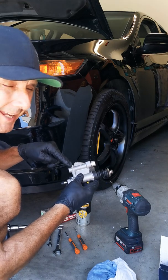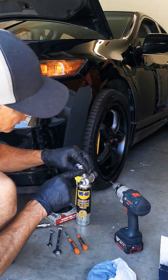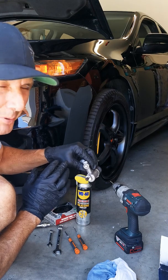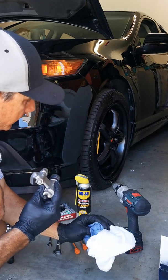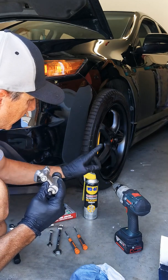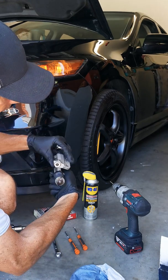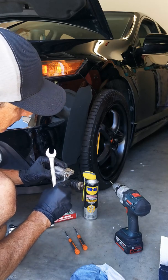The hack I'm showing you is how to get that little c-clip, which is in a channel there, out easily. A lot of guys have said they grind the top of this off to be able to get to the c-clip, other guys say it takes ages and it's a real pain. These are all the tools you need — gloves, a rag for wiping up fluid, a little WD-40, a 12 mil ratchet, a two-and-a-half mil drill bit and drill. To get the lines off, you use a 17 mil for the hydraulic line and a 10 mil to undo that hydraulic line.